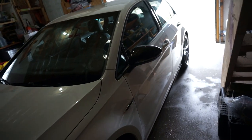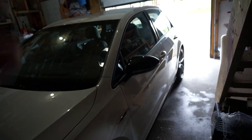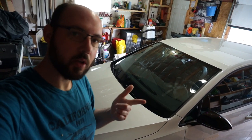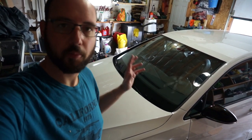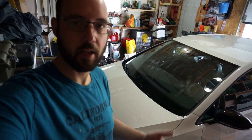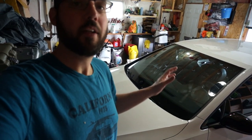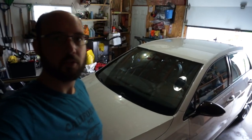In order to get these results, this was a multi-step affair — almost a full day's worth of labor to get it to this point where it has been coated once. So what was done with the car to get here? First, a snow foam wash, then a hand wash, then an eraser — an IPA-based solution that gets rid of road film and oils. Then we slept overnight. The next morning we did iron-based decontamination with Autoglym Magma, or you can get Iron X. Removed all the iron, then clay bar, then polish, then an erase to get rid of all residue from those steps, and then I ceramic coated it.